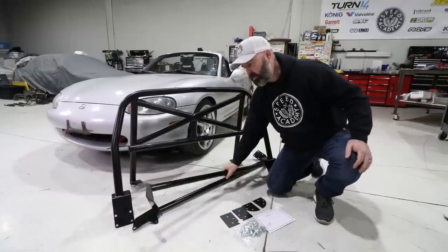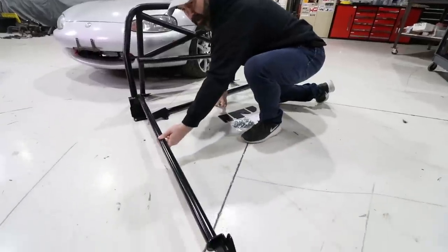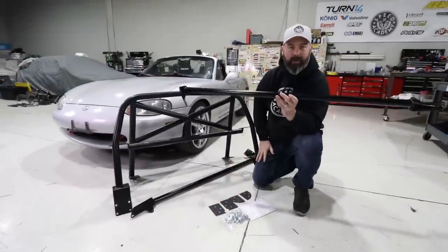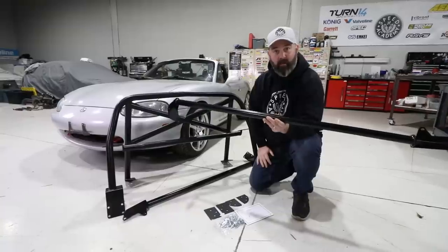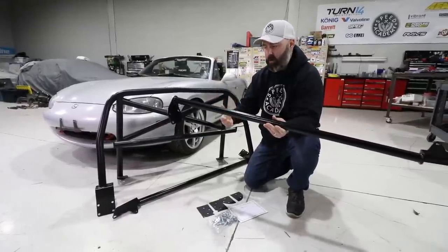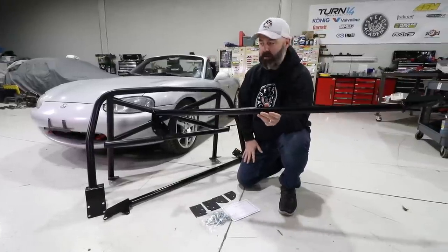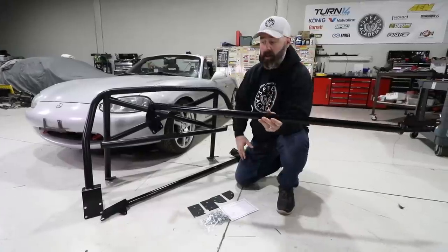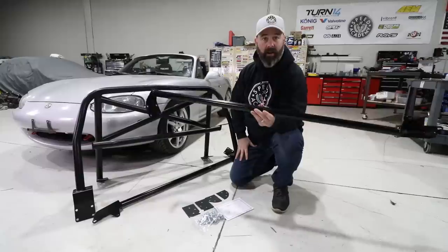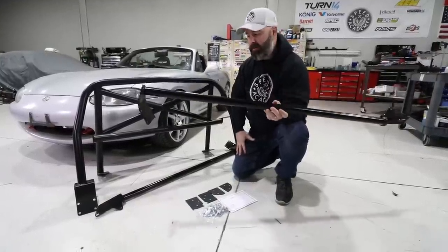They also have these optional door bars, which I think are pretty cool. As you can see, they bolt to the lower mount here and run down to the front side sill area. We're not 100% sure if we're going to be able to fit these in because having taken a look at the Recaro pole positions in there, there's just not a lot of room to go down the side of those seats. The reason we opted for these is they provide a lot more chassis stiffness. By stiffening up that large door opening, and obviously with an open top, this does provide a lot more chassis stiffening. Guys who run these say you really can feel the difference in chassis stiffness.